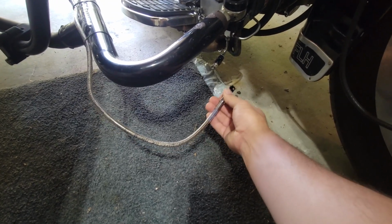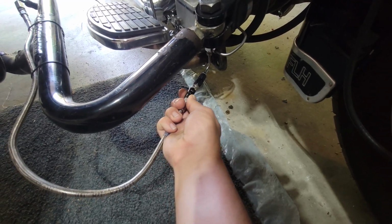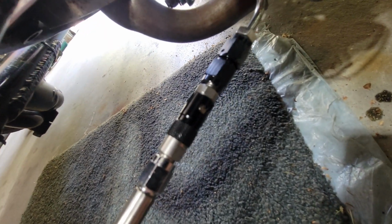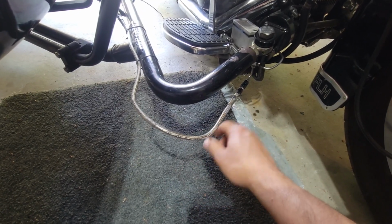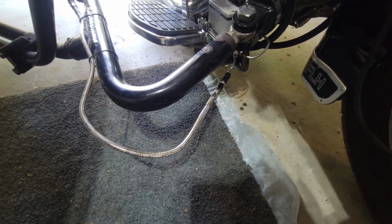And so then the question is, is this a good system, and does it introduce air into the line? And so what we'll do is, and I already know the answer obviously, put this back on, turn it, clips right in. Again, see if this focuses. It's got a little tooth and a little track. And so now, if it worked, when we pull the brake, I can't move the bike. So that means the sidecar brake is working, no air was introduced to the line, and essentially you have a system, or at least from a brake system standpoint, that can be detached or disconnected quickly.